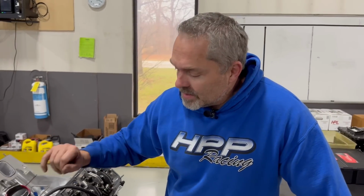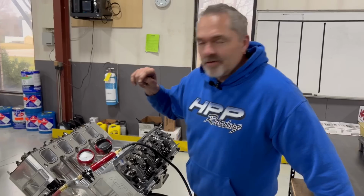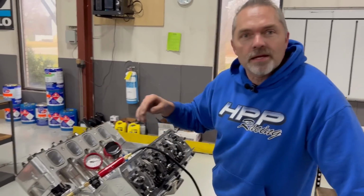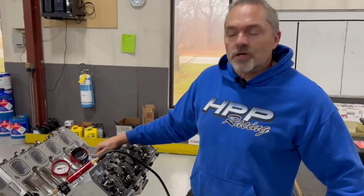You got a 2-inch valve, roughly. So we're just playing rough numbers, okay? If we were playing easy numbers, remember, 2 inches of valve. This is PSI, pounds per square inch. We got 95 pounds of air pressure, actually a little closer to 90 right now. Takes a little over 180 to open it up. You see the math? So here's the big kicker.